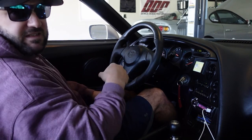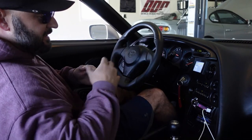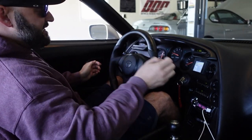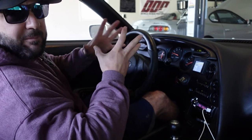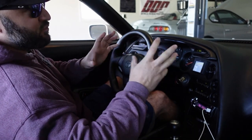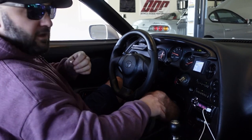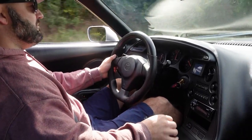Let's test this — I'm going to run low boost. Cold start is actually going on right now. It revved way too high — 2,300–2,200 RPM — way too high. It comes down and meets target though after that initial flare-up. I need to fix that. It was about 50 degrees out, so not terrible, but I don't like that crazy flare-up. I'll have to look at the log. There's about 30 seconds of cold start window time and I want to capture all of that to make sure everything's fine.